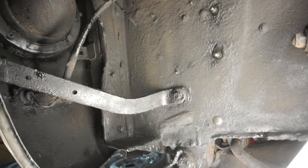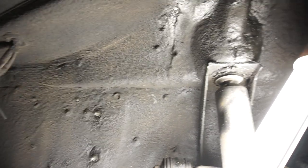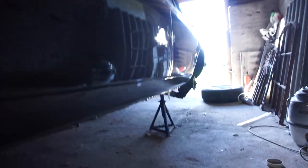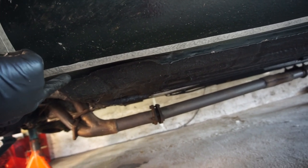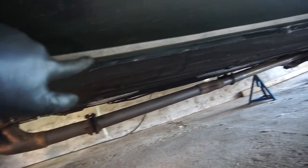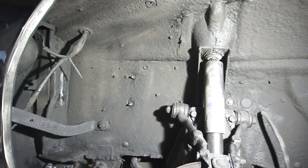Now I've hit everything with at least two coats. In areas with really good old underseal I've done a light coat, but where there was bare metal or cracks treated with the rust converter I put about three coats on, so everything is covered nicely. I'm going to continue with the rest of the car. I've also set up a masking tape line along the bottom of the sill here — you don't really see it when walking next to the car but it gets a lot of abuse from driving — so I'm going to add underseal on this part as well.